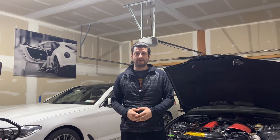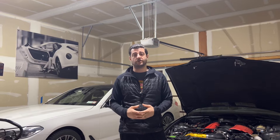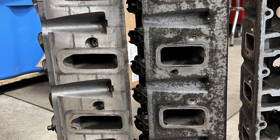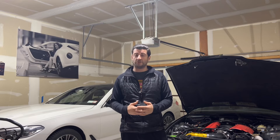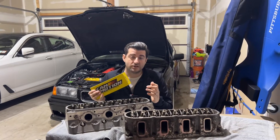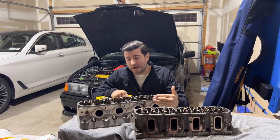In a turbocharged application you can get away with the stock 317 heads no problem, because you're going to be forcing a lot more boost than you normally would with a supercharger. But with an LSA supercharger build, it makes a lot more sense to get better heads than those old 317s, which are cathedral port. LS3 heads are rectangle port heads — great for supercharging because they bolt right up with no adapters and flow significantly more air at higher RPM, which is where we need it. These springs will also allow us to run a pretty aggressive cam and wind up to about 7000 RPM.